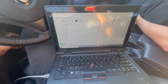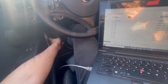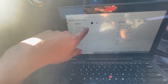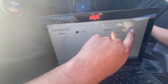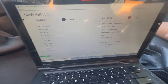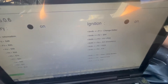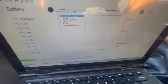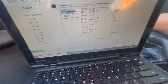There are a lot of ways to code the injectors, but today we're doing it with INPA. We're going to plug in our K+DCAN cable and our OBD2 connection. Make sure your car is in ignition without starting the engine, and the two indicator dots should be on. This is an E92 335 but it only gives us the E90 option, so we press Shift F2 and then go down to Engine.